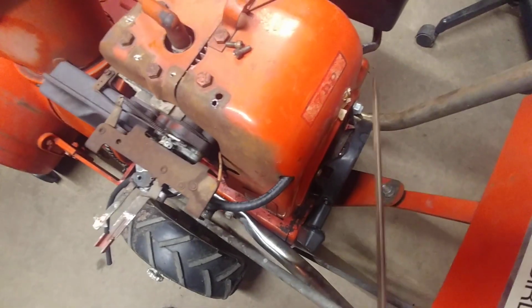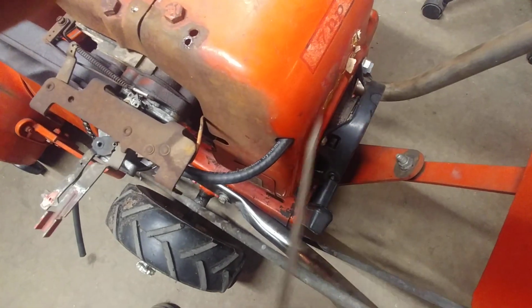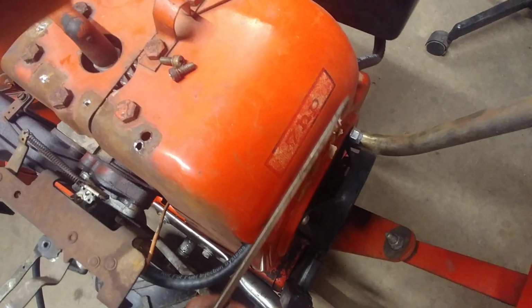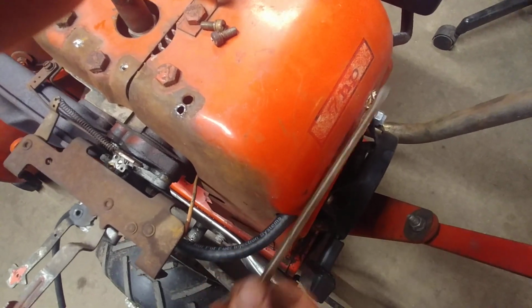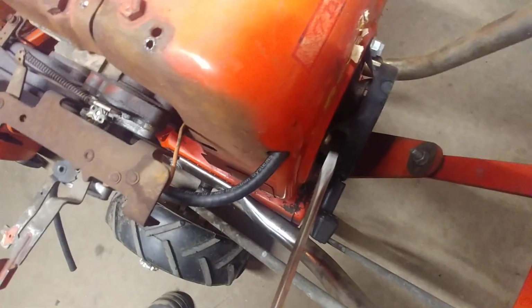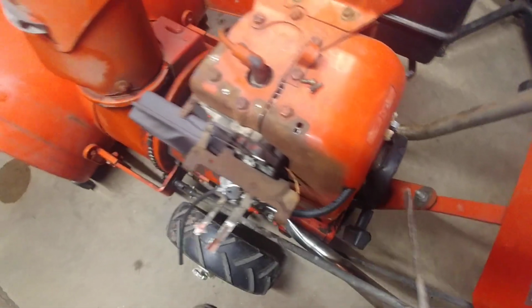sometimes it can be a bear getting gas line through this housing. A lot of people just say the hell with it, running it on the outside. Stick a screwdriver or anything, that'll go all the way through. Put your hose on and then just pull it through like that. That way it comes right through, because there's pieces in here it has to go through and everything.